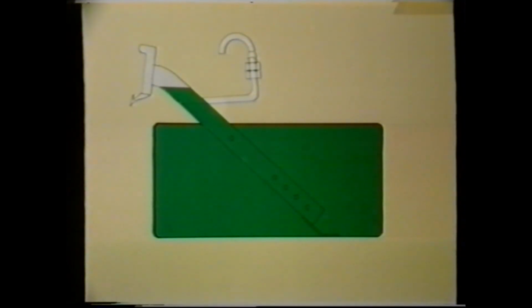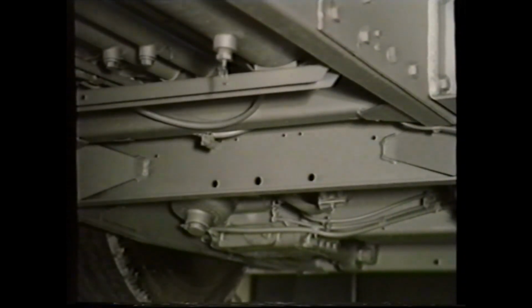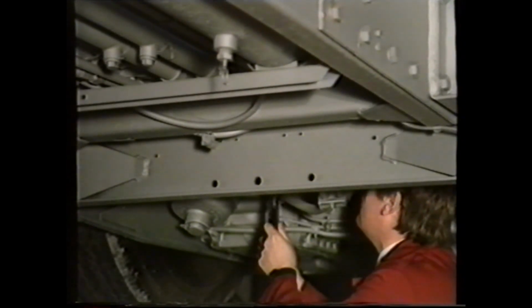If we refer back to the original problem and the fuel tank had not been pressurized, you should disconnect the fuel return pipe close to the engine and run the return pipe direct into a container. Start the engine and check the rate of die-down. If correct, continue to disconnect the pipework in stages back to the tank until the faulty pipe section is identified.